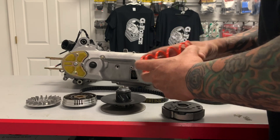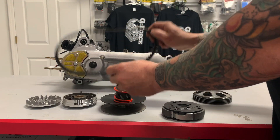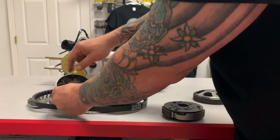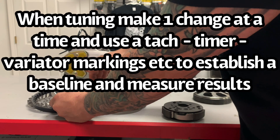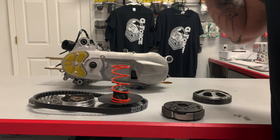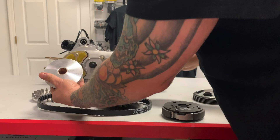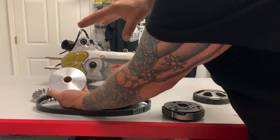The torque spring is the most frequently changed item in the CVT — it provides resistance to the shift. When the belt is at the top and the motor is turning, it's trying to pull the belt up on the front, and the torque spring is resisting that shift. The spring provides resistance in relation to the weight of the roller weights, so they have to be matched based on resistance and shift weight. Not only does it provide resistance to the shift, but when you let off the gas coming in and out of turns, it kicks it back down to low gear — the belt goes back up high on the rear pulley. The front pulley is connected to the crankshaft, and the belt rides up from the bottom to the top to get that transmission ratio, like a 10-speed bicycle, so it goes faster.